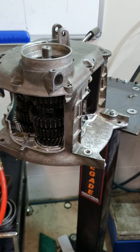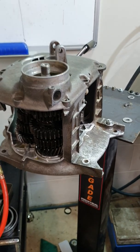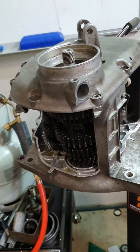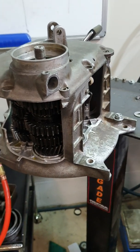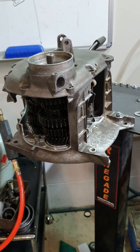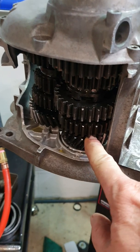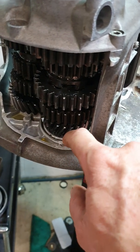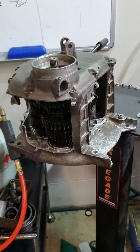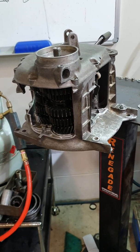Even though they're an agricultural thing - they were in tractors back in the 20s and 30s - they are a very strong and robust gearbox, very simple. But like the rest of the bike, they're very complicated if you don't know how to set them up. There is not one thing you can do in these boxes that you can't put in backwards - all the thrust washers can go in backwards. I pulled a gearbox apart that had a thrust washer put on the wrong side of the gear, and that was causing all the grief.